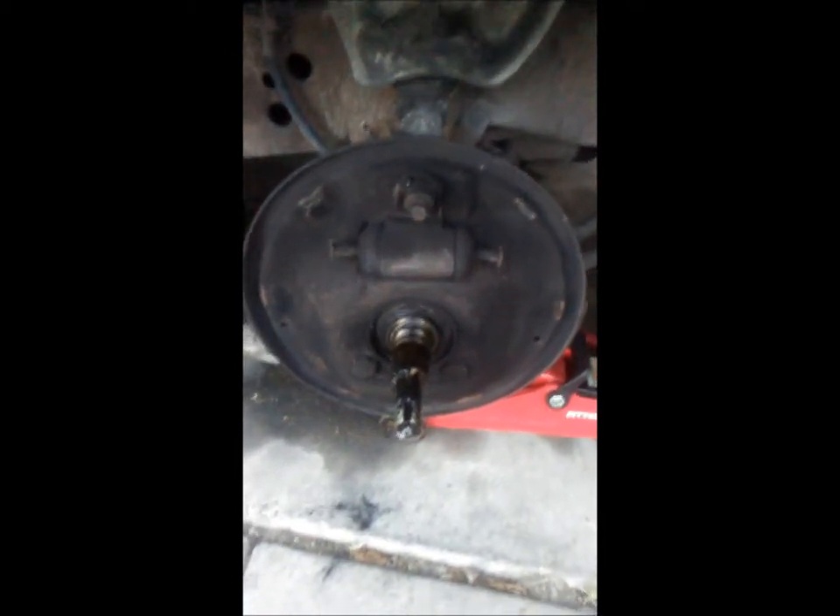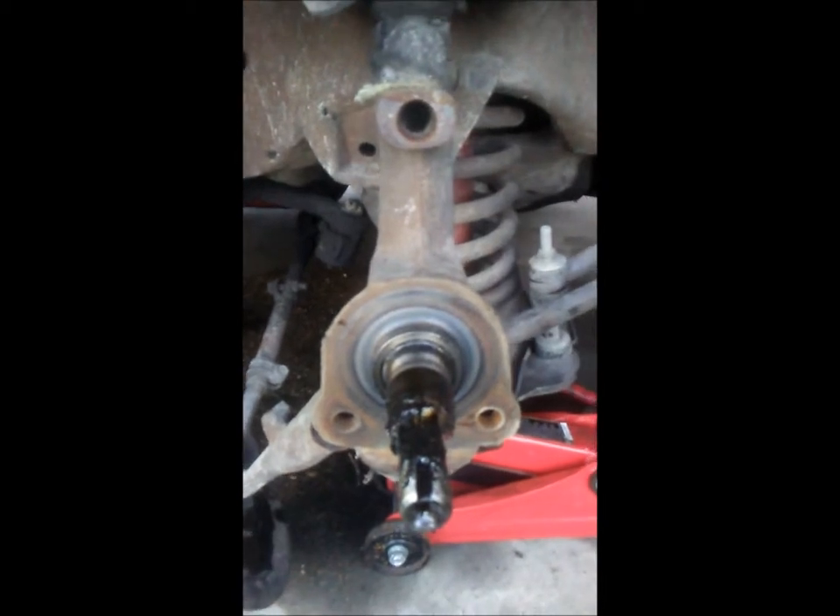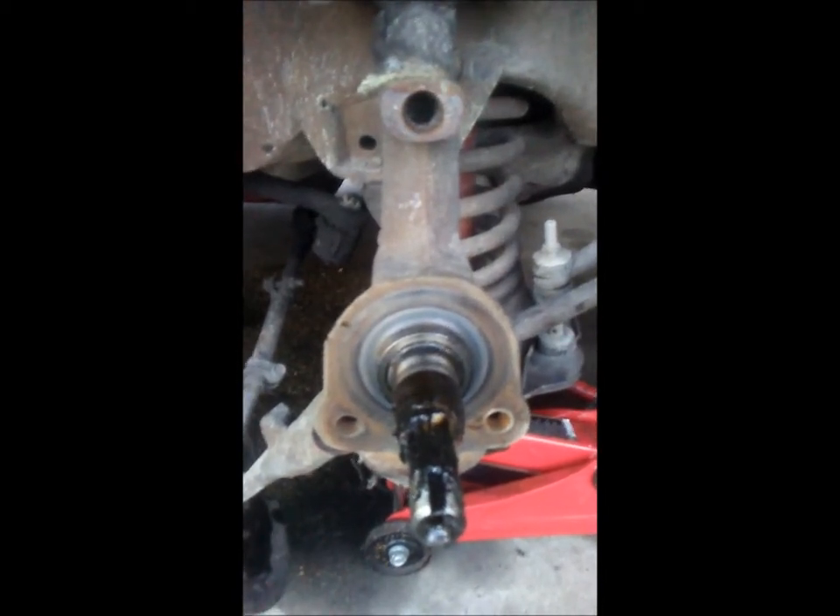She's ready to come off — loosen your brake line and pull this off. These two bolts come off as well. Notice these two bolts: one is longer than the other — longer here, shorter here. That's going to be important real soon. Okay, all that's off.